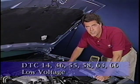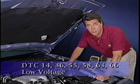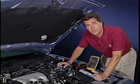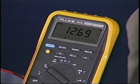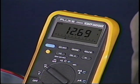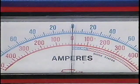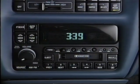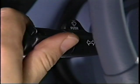Codes 14, 36, 55, 58, 63, and 66 may set due to low system voltage. If the charging system allows battery voltage to drop near or below 9.6 volts, the EBCM disables ABS and sets these codes. The charging system must produce enough current to exceed demand. Starting an engine can cause a sharp current draw of over 200 amps. Then add the rear defroster, the radio, the climate control system, the headlights, and the wipers.